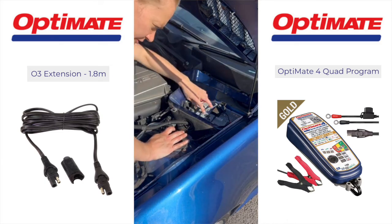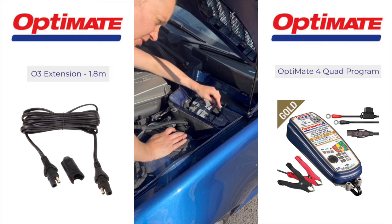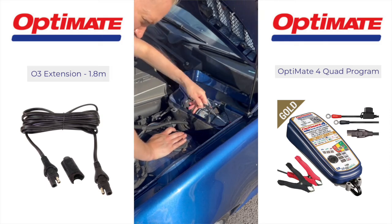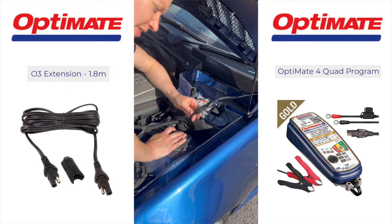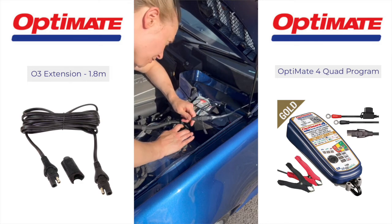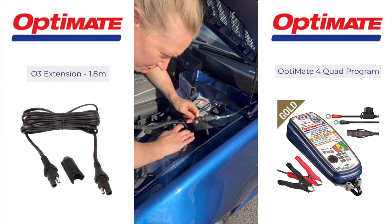So this is how I've picked up the terminals off my battery. OptiMate give you a positive and negative connector kit, fused on the positive side. I've clipped it over the positive and negative terminals, fed it through a waterproof vent, and then started the first extension lead to take it through to my garage — routed somewhere convenient so it isn't going to get trapped under the bonnet or around the sills.